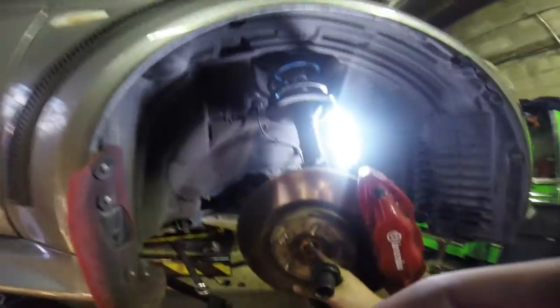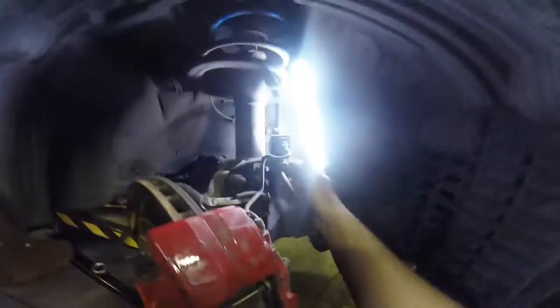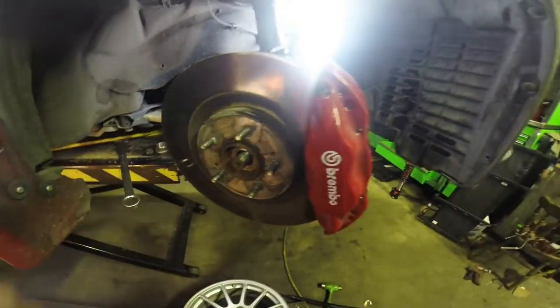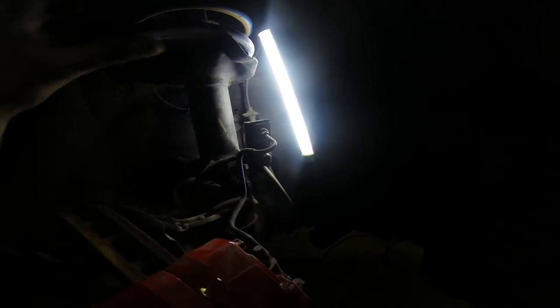After we take off the axle nut, we're going to take these two 19 millimeters off here — that's going to take off the whole caliper — and hang it on our body panel there with some zip ties. We're also going to disconnect the ABS: there's a couple of 12s here. This 12 is for the ABS, there's another 12 there, there's a push pin to pull out to give enough play on the wire so we don't damage it. This white C-clip here that goes around has two indentations — we're going to use a screwdriver and just pop it out. The rotor comes off, then the two strut bolts up here, both 19, and that frees up the strut tower.